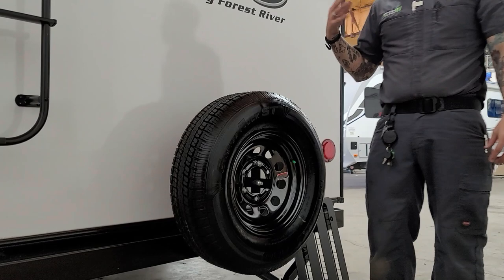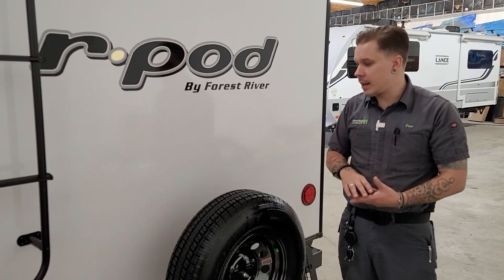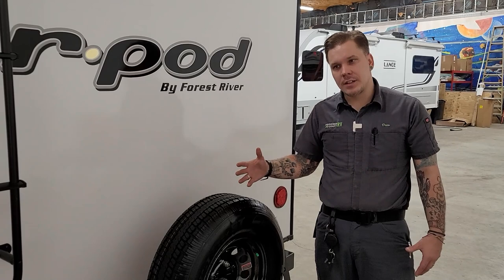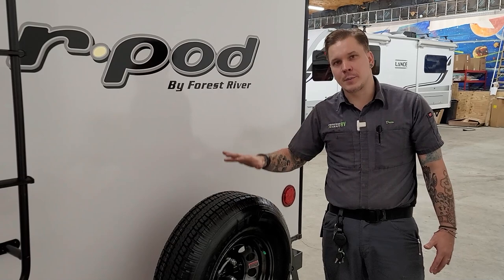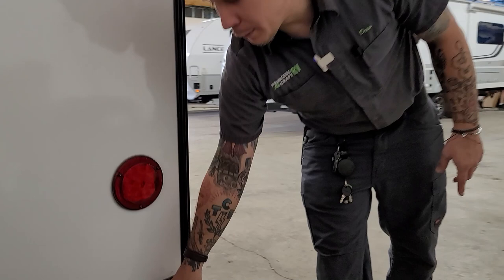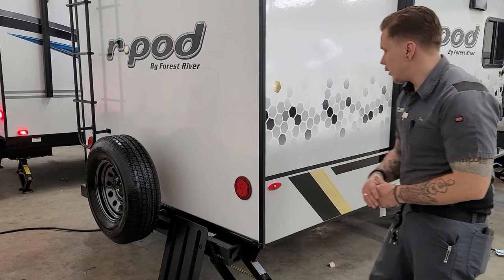We also have your full-size spare tire here on the rear. When you need to change a tire on the unit, place your jack directly on the axle as close to the tire as possible without interfering with your work, and jack the unit up from that axle point. Once you've changed the tire, remember to go through the retorque procedure at 15, 25, 50, and 100 miles. Tube storage here on the bumper — each side has a removable cap where you can store your sewage hose or any long items. Just a friction fit; pull and it's easily removed.